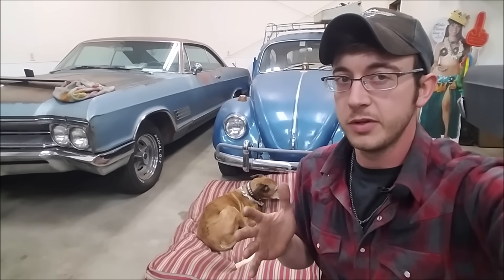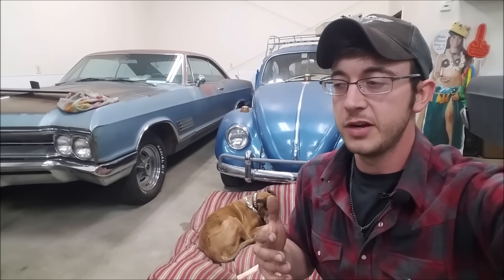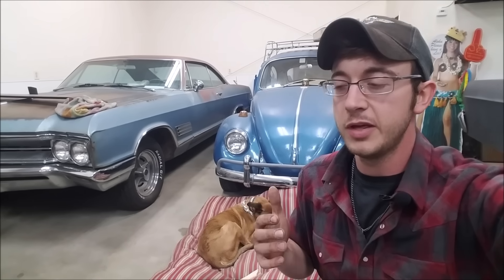I'm not really in love with either option, but for street engines I've seen that ported vacuum works really well. I'm not a huge fan of all the compromises you have to make with these old school engines with ignition timing that are inherent in the overall design of a distributor — the limitations associated with weights, springs, stop bushings, vacuum advance, and everything. It's pretty good but it's not completely perfect.